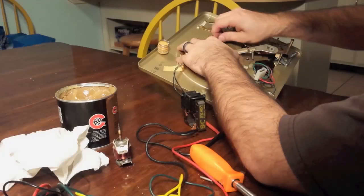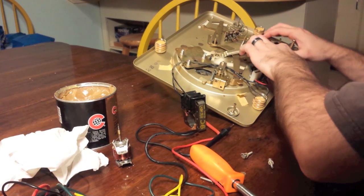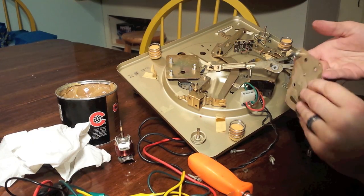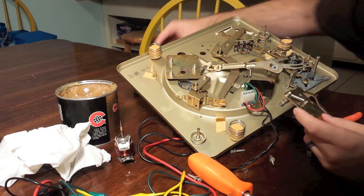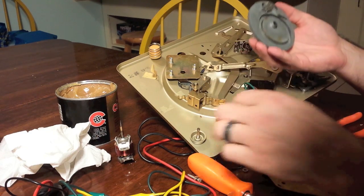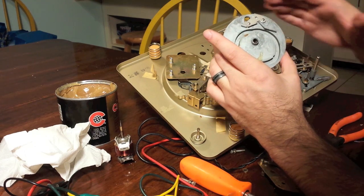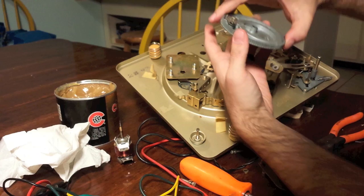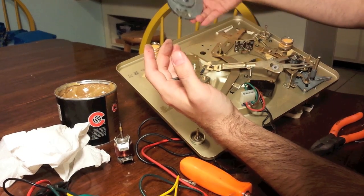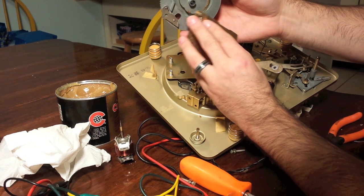That guy does not want to go. Okay, that was slightly annoying. So I had that snap ring on the other side that drives the return mechanism. Don't lose snap rings. This hub here has a groove, and this is what drives the turntable's tone arm return mechanism — it's part of a gear drive on the other side of this.